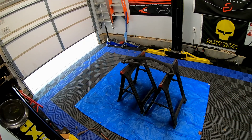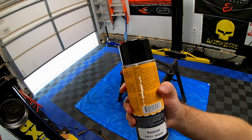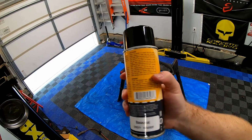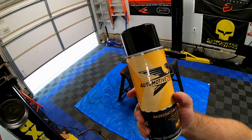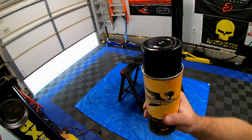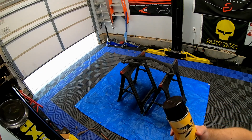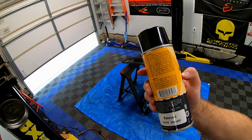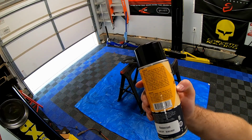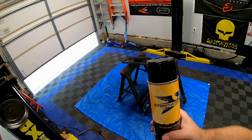I've got this automotive touch-up paint. This is the dark Phantom Black Metallic DBPM. WA690F is the black. And this is a pre-mixed base coat, and this will require a clear, so we do have 2K clear for the rest of the grill, and that's left over from the truck as well. Now the WA690F, I did buy this specifically for the grill project, so I have plenty left over. We'll do two, maybe 3 coats of this.